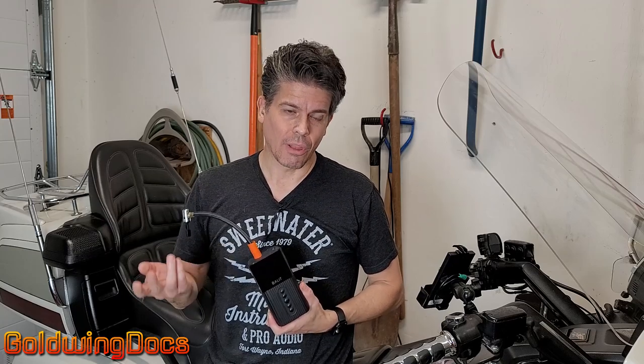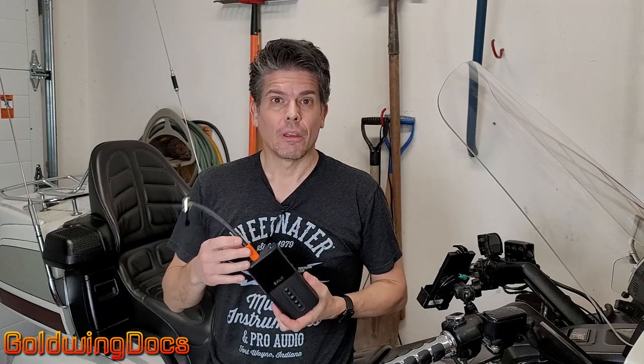So what do I think? Honestly, I didn't expect much. I expected it probably wasn't going to run long enough to inflate my tire, or that the battery would run out, or it wouldn't reach 47 PSI. That's why I picked my rear tire — it's larger and takes higher pressure than the front. But it actually did it. Would it be enough to fill a car tire? Maybe — car tires are probably closer to 30–35 PSI, though they're larger. Would it fill a big truck tire? Probably not. That said, I gave it the worst possible situation where the tire was completely empty. Usually your tire has some residual pressure, so it's not starting from zero. It definitely runs hot.